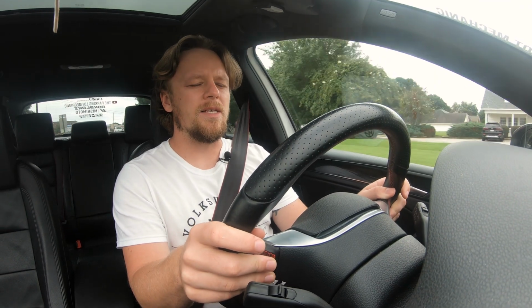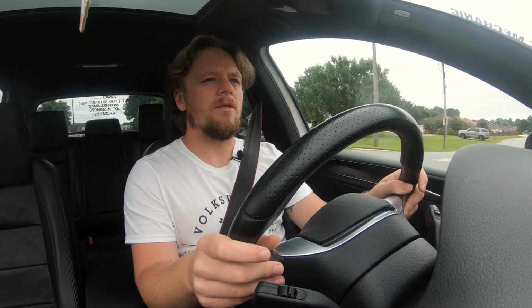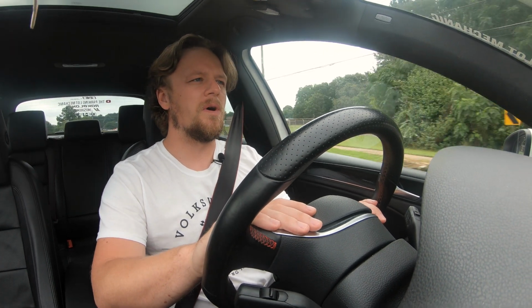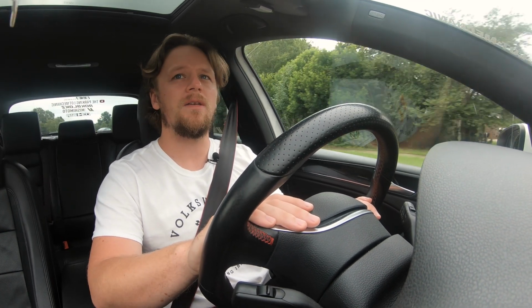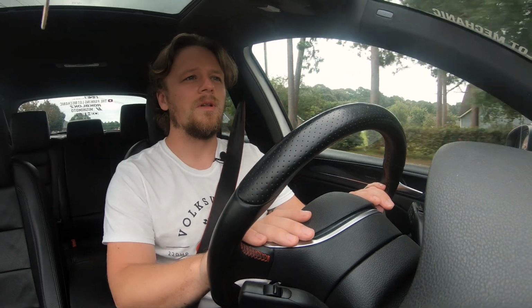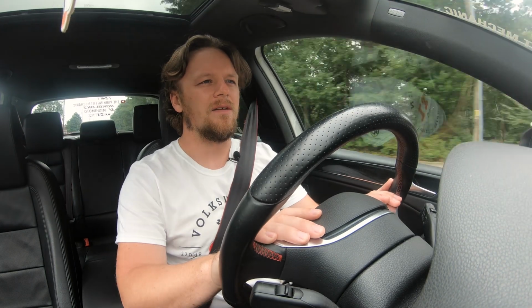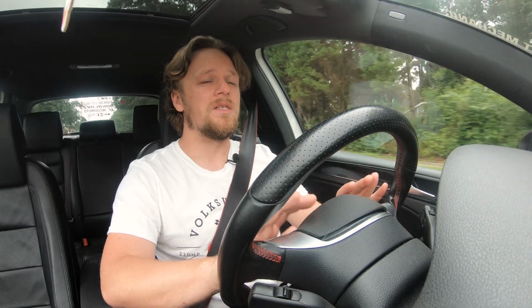Now, the adjustable end links that I've put on actually help with preload, so the sway bar isn't loaded up on one side or the other, so it's just perfectly level across the board. And I'm glad I did those. I know ECS says you can use this 23 millimeter bar with the stock end links, but they recommend using stiffer, beefier, adjustable end links in the end. So I was gonna replace them pretty quick. I already had them with me. But I'm glad I did because these fit great. Everything's adjusted very nicely so that this is handling insanely crisply.